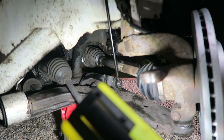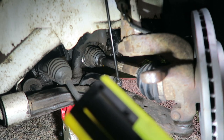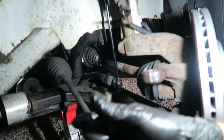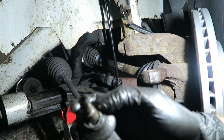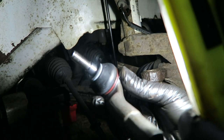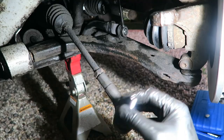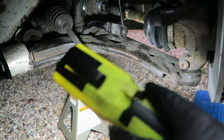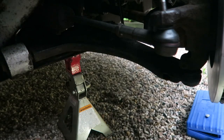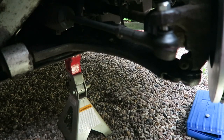I'm going to grab the new one. Look, again this old one is really moving and all completely busted - you can see all the grease with exceptional dirt in there. There's the new one - you get a protective cap with it which I've taken off. Then all you do is the reversal, so I'm just going to do 17 turns back on. And then basically I'll tighten up this bolt again. Obviously I'm going to get the tracking done afterwards. The new bolt is a 17 rather than the 15 that was on there.